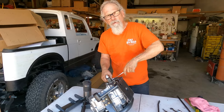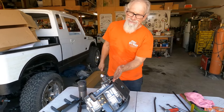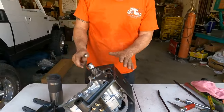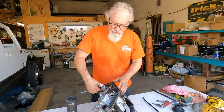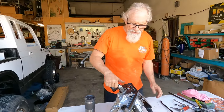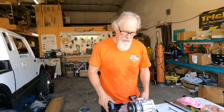Now, if you had a rear drive shaft disconnect, or if you had a disc brake on your T-case, all you have to do is cut this back plate off right where my finger is. You just cut it off, and now your accessories are going to bolt on, and that's why we call this a 14 to 17 bolt super cradle. This is the reinforced version because I've had some big rigs tear these up. I've had some people jump off of 10-foot walls and land on rocks on this, and so we just keep making them stronger and stronger.